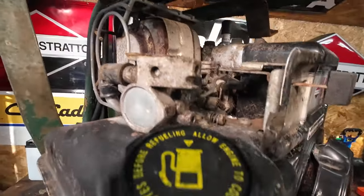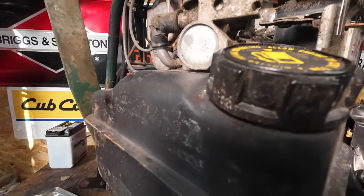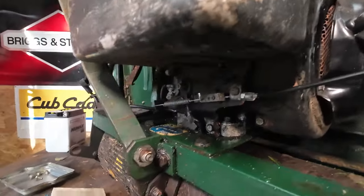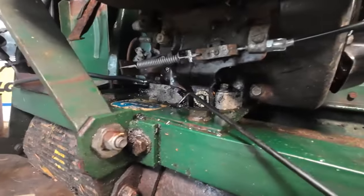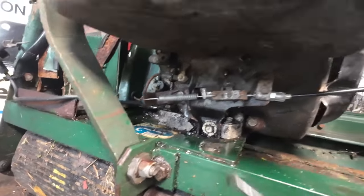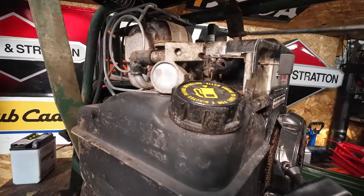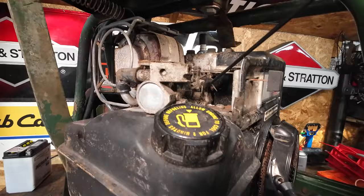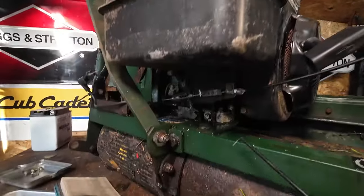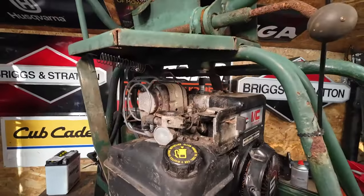this as one unit, where you take the carburetor off of the tank. That won't lift up like that because there's nowhere to go. So you have to physically remove the bolt down here, that one, take all these gubbins out here, and disconnect all that lot there. Once that one's loose, that will give you a little bit of free play, and then you can start to loosen it all up and it all comes off together, and then that will come off the manifold off that bolt at the back there. So let me get that one done first, get him loose, and then we go from there. If I hit any more snags, I'll let you know.